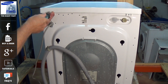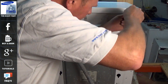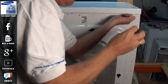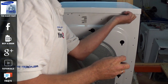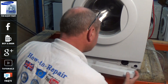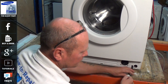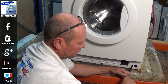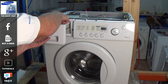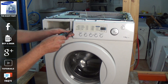Before starting any work, make sure you unplug the machine from the electricity supply. We're going to remove the lid. Because the machine has timed out on one of these two failures, we need to kick-strip off and drain the machine down, as it will already be full of water. Your clothes are most probably stuck in the machine, so use the drain pipe to let the machine drain down before starting work.